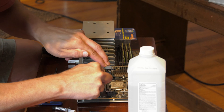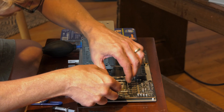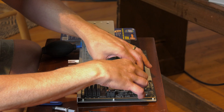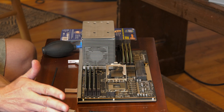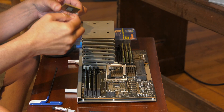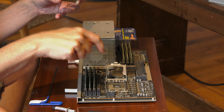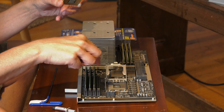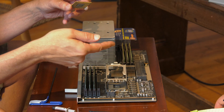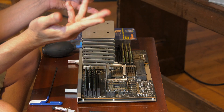So this goes down and out. What happened to me on the last one — the processors I got came with a bunch of gook on the side, and somehow that gook landed between that and this on my second CPU. On the other side of that, all those little connectors touch all those pins — precisely. They have to be touching each little pin, and if one of those is bent, you're in big trouble. In fact, the guy who just tried to do this upgrade on his 2009 bumped it, bent a pin, then tried to bend the pin back and it snapped off. You're screwed.